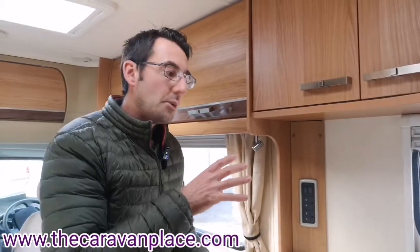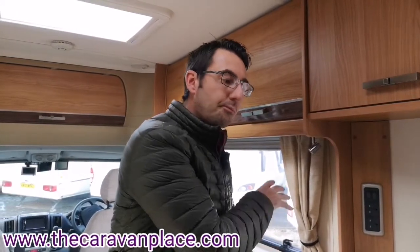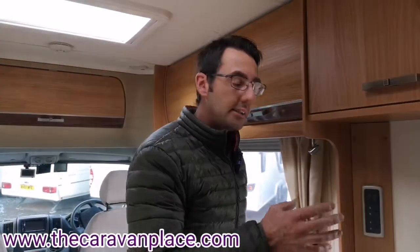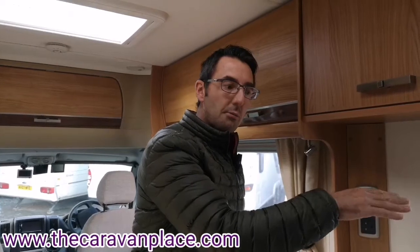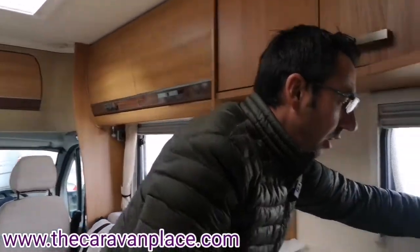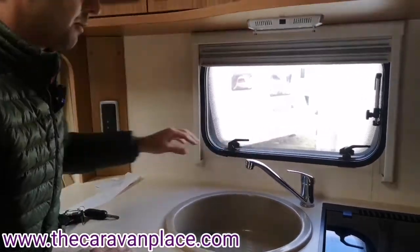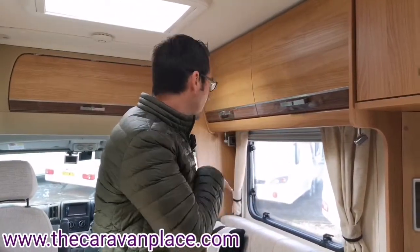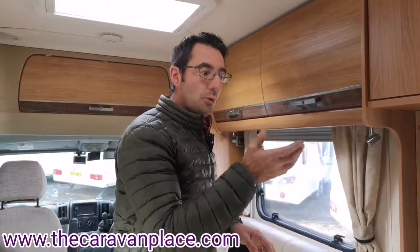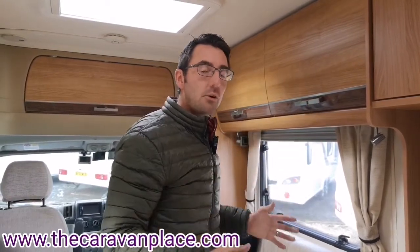Once we've checked that, we can pop our water pump into the on position and that will put all of the water supply to our taps. If you drain the system down, the water tank for heating our hot water is going to take about five to ten minutes to draw water through and fill up. When you do the water for the first time after draining the system down it's going to be coughing and spluttering for a good five to ten minutes. Once we've got a nice flow of water on the hot and the cold we know our water tank for heating is full and we can go ahead and put our water heater on - either on gas or electric. We want to draw water through on the bathroom tap and the shower tap to get the system fully primed.